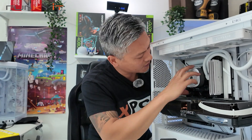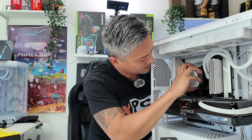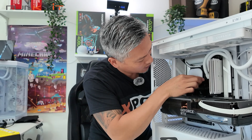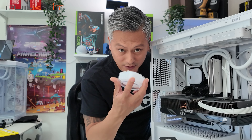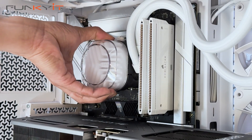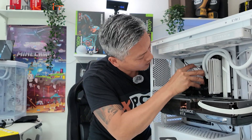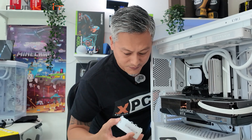All you've got to do is quite simple — you just grip it here top and bottom and pull it out like this. You can see the actual water block and it comes with the 20 RGB LEDs already included. Then put the groove cap on and just lock it in place just like that, hear the click, and you're done. You can easily swap these out anytime by pulling them and swapping like that.